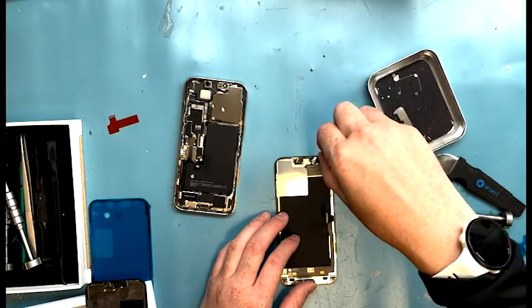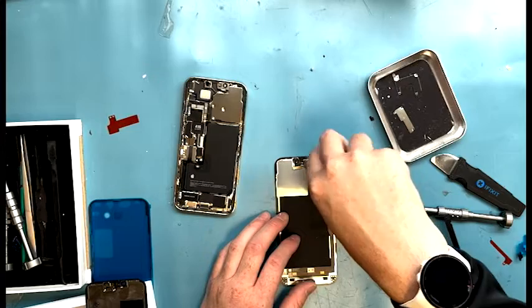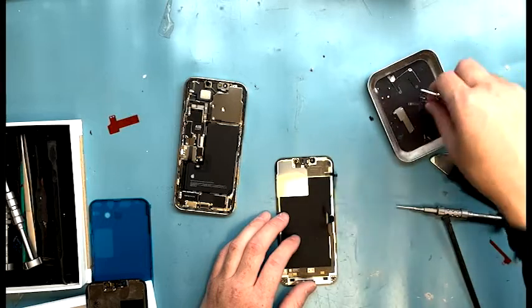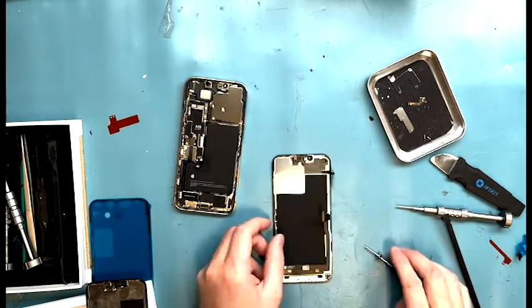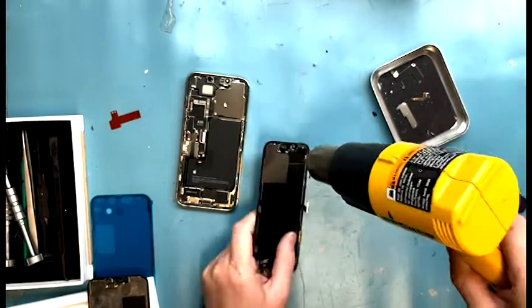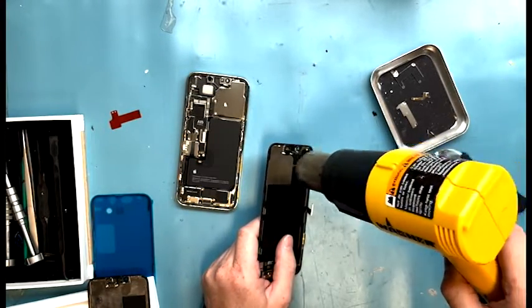You'll want to use a lot of heat and I use acetone mixed with isopropyl alcohol — it breaks the adhesive. That allowed me to get the proximity sensor off. Be super gentle with it. I'm not sure what will happen to the phone if you break it given how the proximity sensor works on newer phones, but I struggled to get it off.